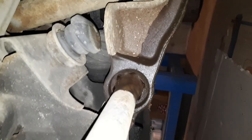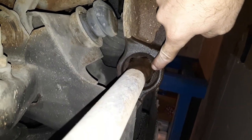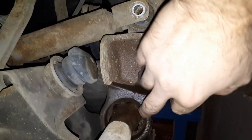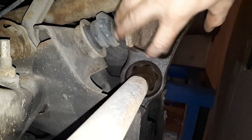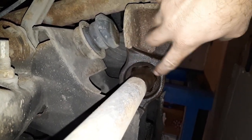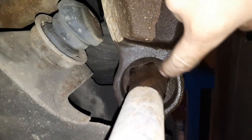What's going on here is this torsion bar is already loaded — it's been loaded and torqued on by the A-arm. It's no different than a socket on an old worn-out nut or bolt. You put a bunch of torque on it and it's bound up. The only way to get it off is to back the socket off. That's all we're going to do — twist this torsion rod in the opposite direction that it's loaded up.